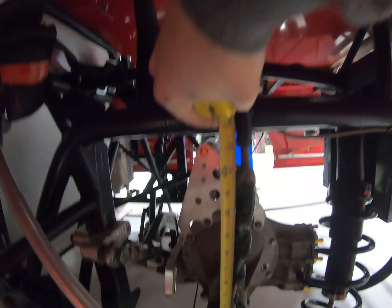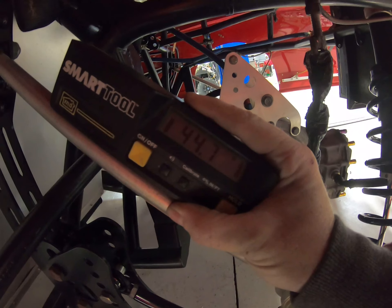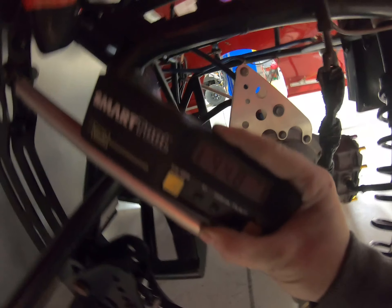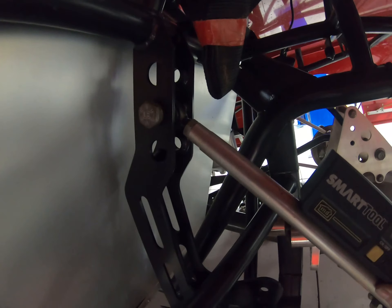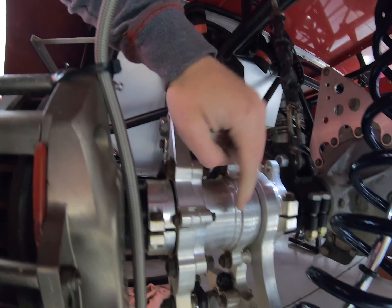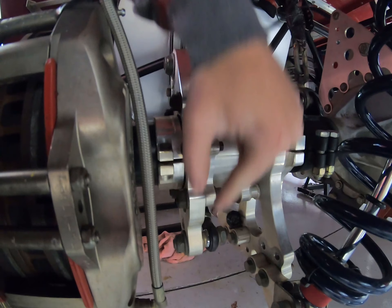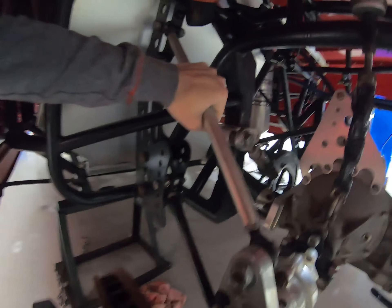From the axle tube up to the frame rail is where you measure your drop numbers. When you measure your drop, the other thing you want to check is your bar angle. I try not to exceed about 48 degrees, but maximum of 50 degrees when you're dropped out. If you drop a car and it's below that, you need to drop your rod on your frame. Your bar positioning on the birdcage has a lot to do with the upper angle when you're in drop, so always make sure baseline settings are 4 and a half inches — center of the bar to center of the axle tube — same on the bottom. It should be a 9 inch spread on both right rear and left rear. That way you know your bar angles are right and you're not exceeding that 50 degree mark.